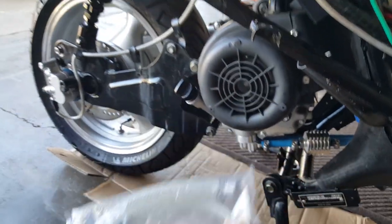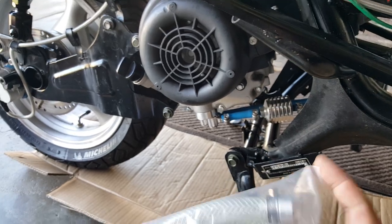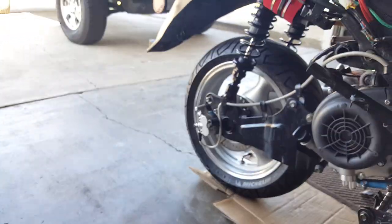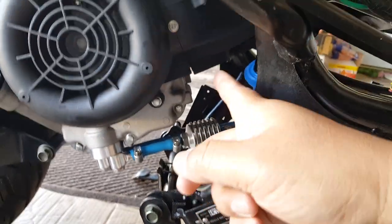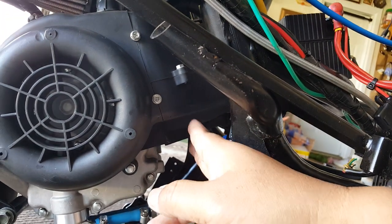So we're going to put the decompression tube on as soon as we find out our oil level. The way we do that is actually start up the motor real quick, let it siphon a little bit, let it cool down for a little bit, and then we can check the motor oil before we put the decompression tube on, so that'll be last. Now before we crank our motor, I just don't want any dirt or anything to get trapped underneath that exhaust port again, because it's going to blow out carb and that little black tar ugly buildup.